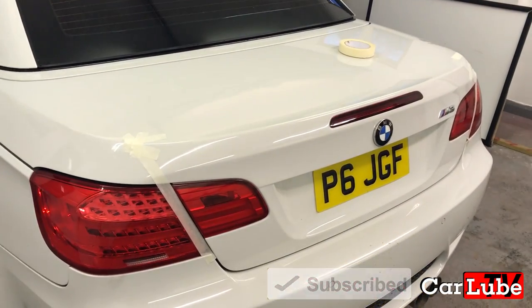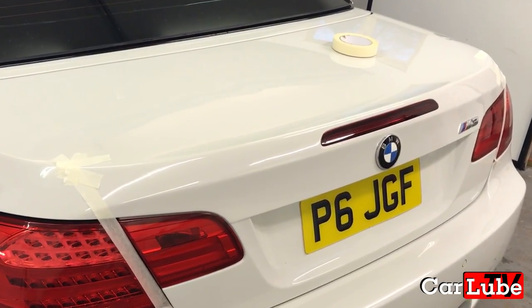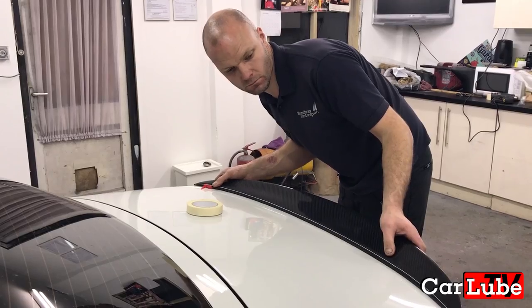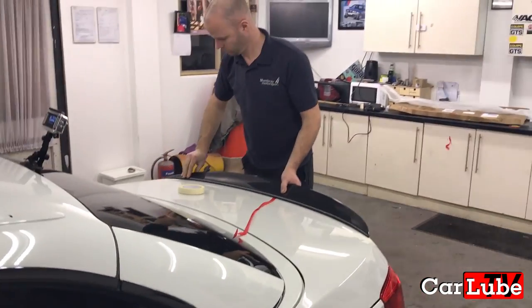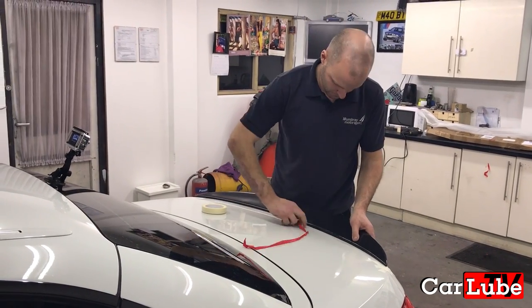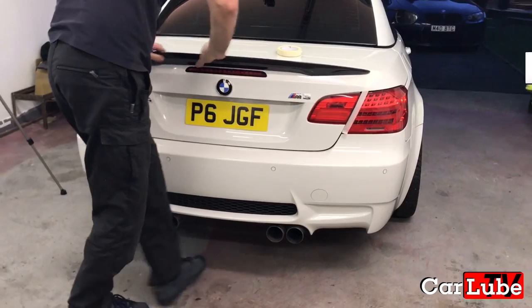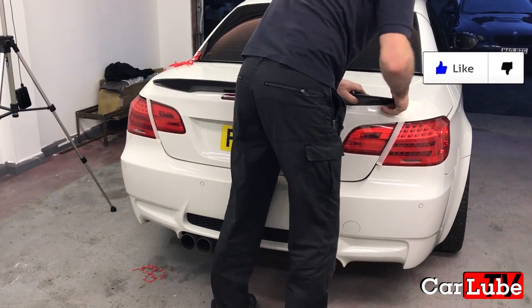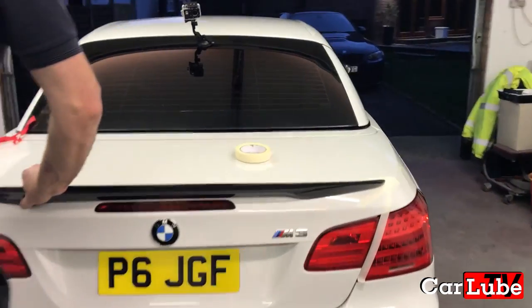As you can see here, with the spoiler removed we now have a clear masking tape positioning marker. So now it's time to place the spoiler on the boot for the final time and peel off the tape. You can see the tape on the front of the spoiler is being removed first and then at the rear. You will need to apply a fair amount of pressure to the top of the spoiler, helping the tape activate and adhere as strongly as possible to the boot lid.